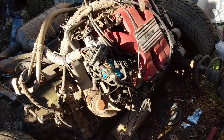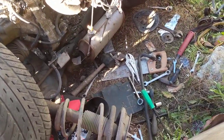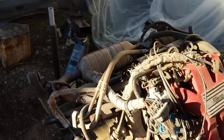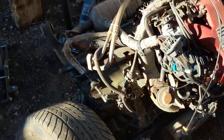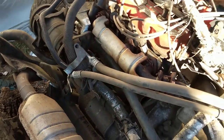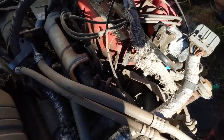It's out — took about four hours. Here's how we did it: we took the four bolts out right here for the engine cradle, dropped the struts, disconnected the fuel lines, disconnected the shift linkage as we did yesterday, throttle cable, and laid the harness over the motor.